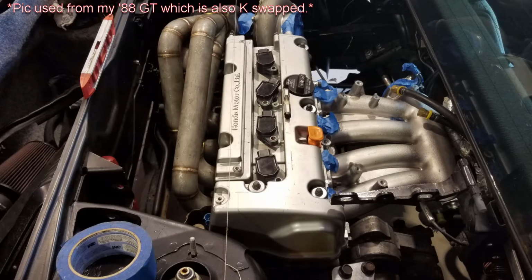I'd like to bring the engine back about 1/4 of an inch, but what I need to do is tie a line across 2 of the strut tower bolts, which I'll edit in a picture here, and run my line across there, and that'll be my straight edge. And that way I can take that edge and measure from there to the valve cover, just so I'm sure that the engine is perfectly centered and it's not cocked any direction. I'm paying very close attention to axle angles. I want to try to get it as straight as humanly possible.